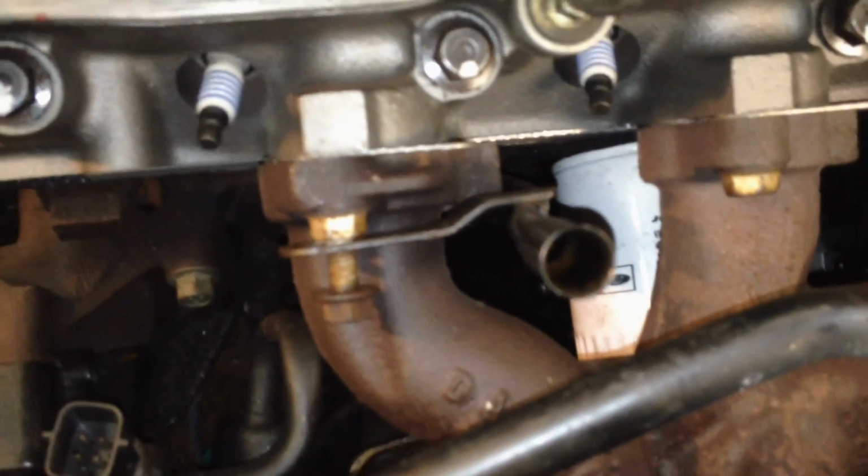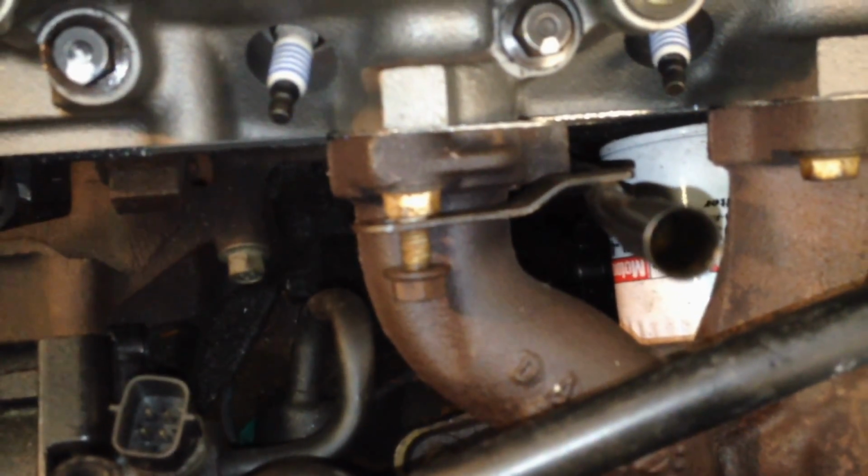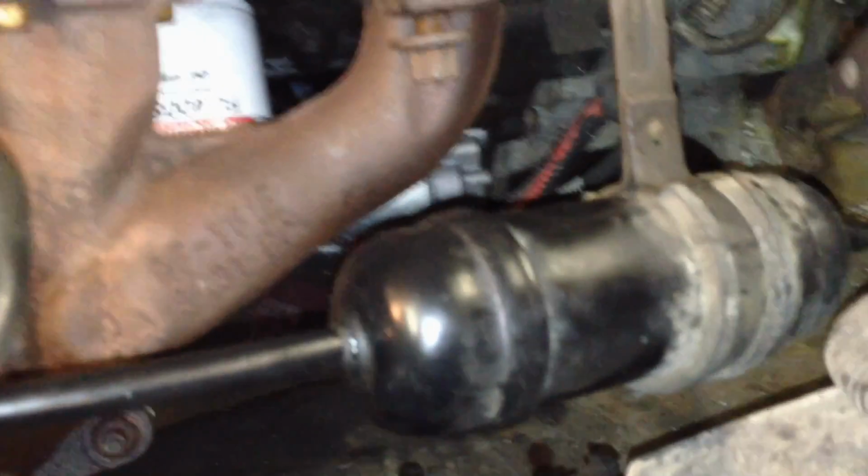And we can lay our spark plug wires over and under like they were, just so they're out of the way of the harness, because we're going to start messing with that too. Let's put that dipstick tube back in, and then tighten that nut down. And then if you did move the power steering line, get it back on the stud, and we're going to keep the bolt loose for now, the nut, until we actually put the pump in and align this fitting up.